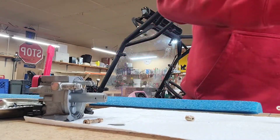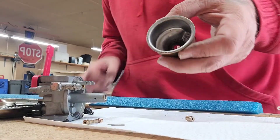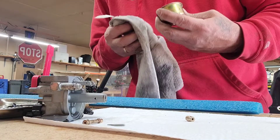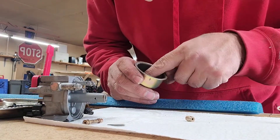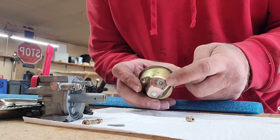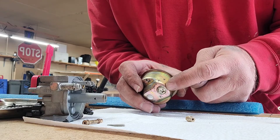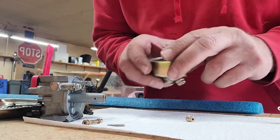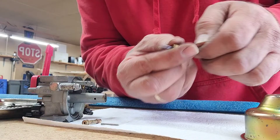Here's your pin. There's still a little bit of debris — I should have put it on for 30 minutes instead of 25. Rough them up a little bit. It's okay to have a little pitting because this is steel. Make sure this is nice and tight and the seal is not torn — if you don't have to take this off, do not take it off. Here's your main jet — goes right through, nice and free and clear.